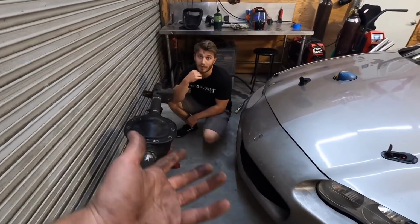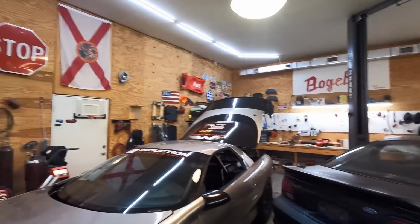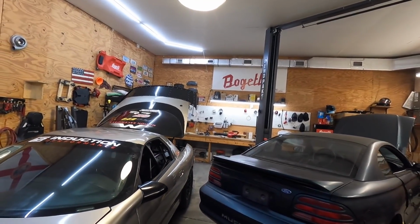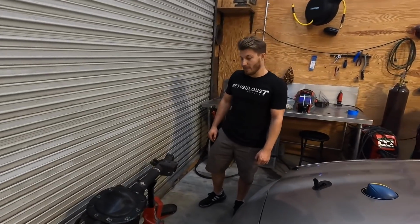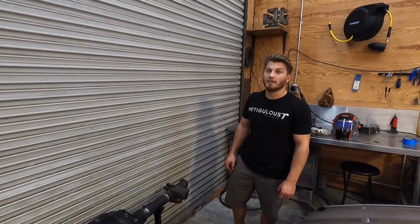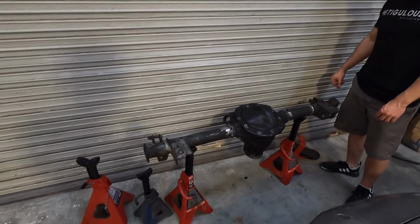Realistically, with a Holley, you just load up their base tune, hit send to ECU, and it just runs fine. Yeah, you go out there and run an 8-second pass, basically. I've seen people just set it up, and they're like, "Yep, there you go." It's not the best way to tune your car, but it works. Wait till you guys see me set up this Terminator. You select LS firing order, like you just select stuff and it just works. It just auto corrects all the fuel, basically, like 30 or 20%. It's insane. Pumps fail and it's just saving you.